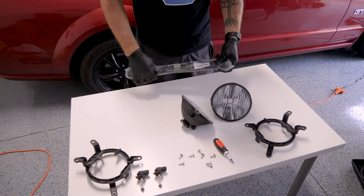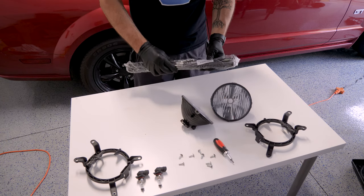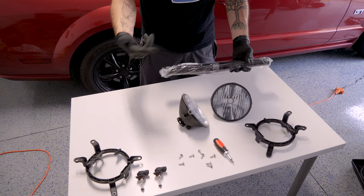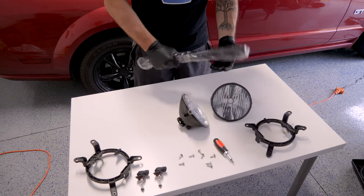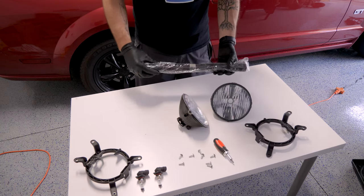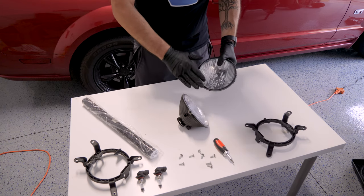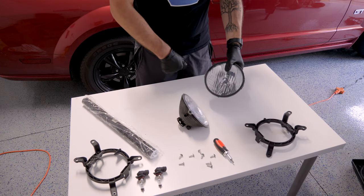You want to grab your tint film. I got this — Vivid Dark Black. You don't need a whole lot; I think this was under 20 bucks and I'll put a link in the description below. I got extra dark because I'm just doing the fog lights to try to reduce how bright the front end is, not the headlights. We want to clean and prep these — I'm going to do a Windex first to do the bulk of the work, and then prep them with isopropyl alcohol to get any remaining residue off.